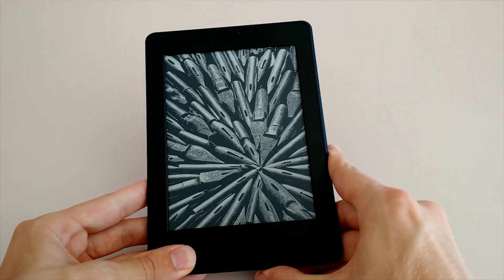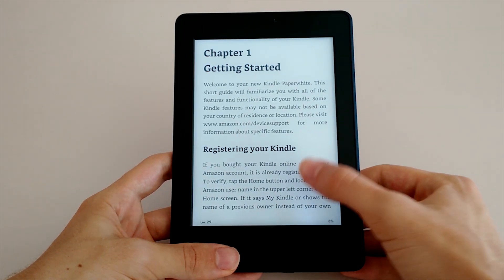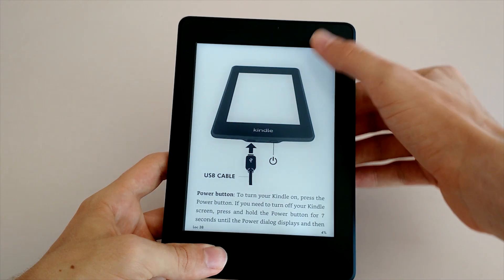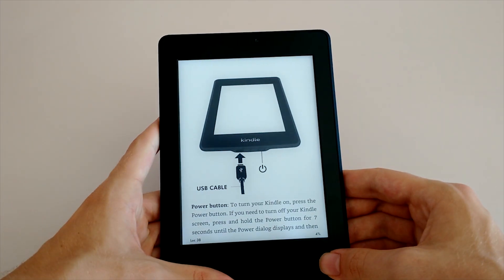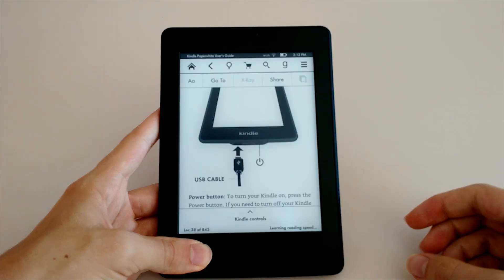The Paperwhite has a 1GHz processor and 512MB of RAM, which is actually an increase from the second generation's 256MB and makes for an all-around faster performance. It uses 802.11 WiFi or 3G data on AT&T's network to download ebooks to its 4GB of storage. There is no external memory support, but there is a free cloud storage option so you can carry your ebook library across any variety of devices that can download Amazon's Kindle app.